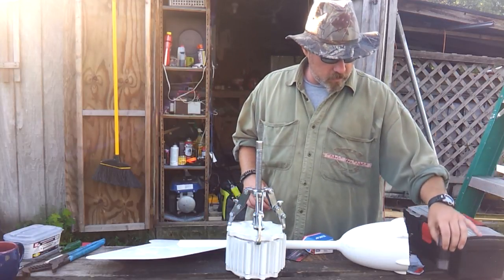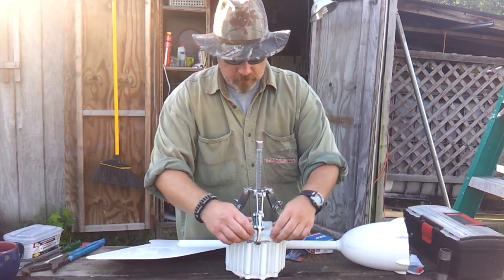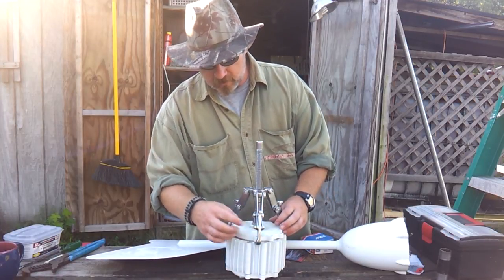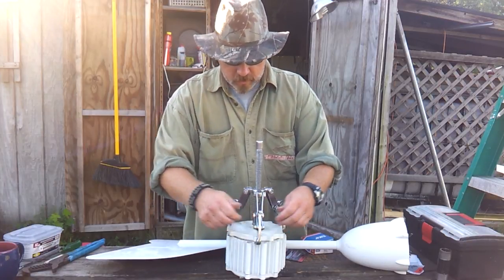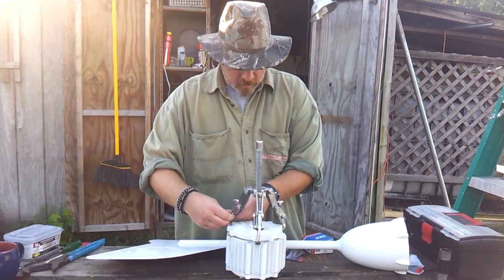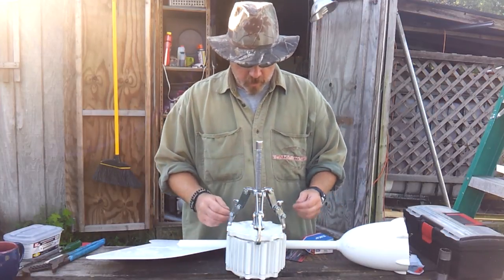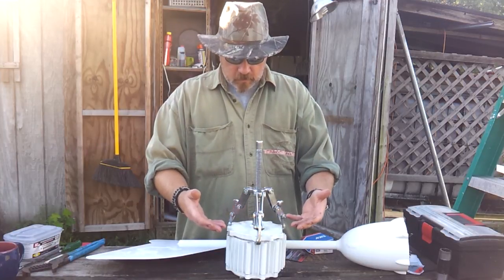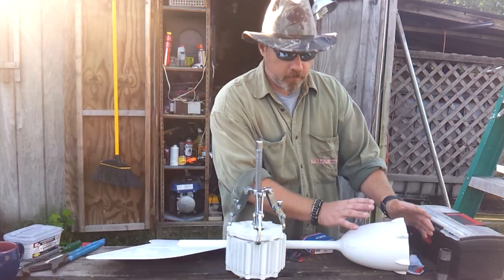You'll also need a puller, and this is comprised of two different pullers, a small and a large. I've taken the arms off of the small one and put them on the big one so that I can get the extra reach — they're a little more nimble for reaching under and grabbing everything. So, I've already taken the bolts out and separated the head from the body.